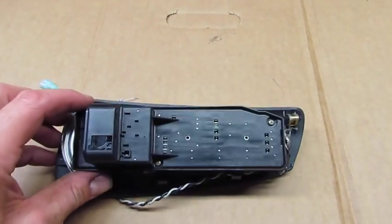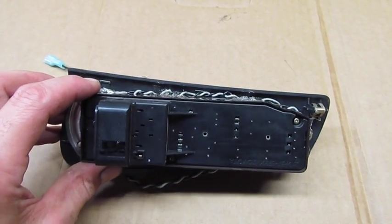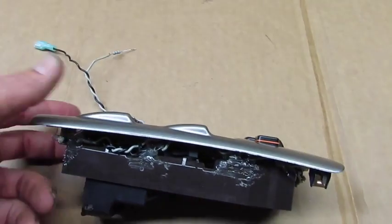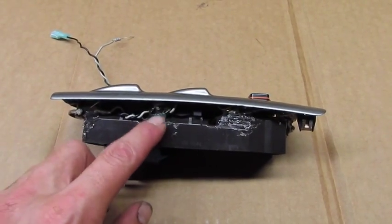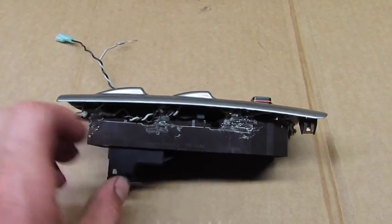The hardest part on this is making sure to keep your wiring and connections recessed. You have to keep it within the side there so you can't see it, otherwise when you try to put this module back into the door it won't fit because of the overlap of the wiring or any associated hot glue or anything you're using to hold the wiring in place.